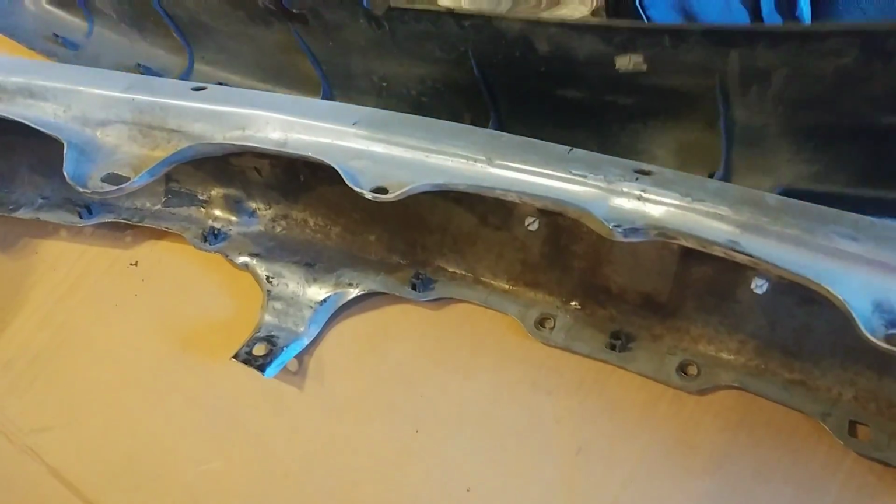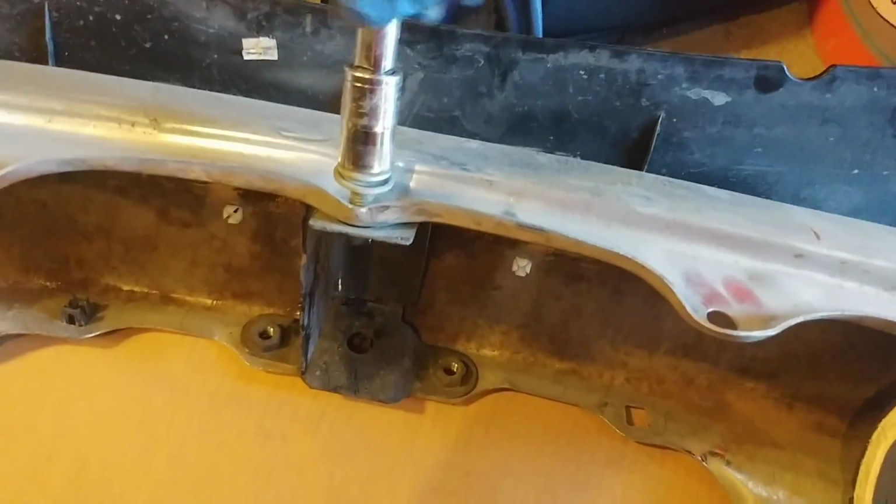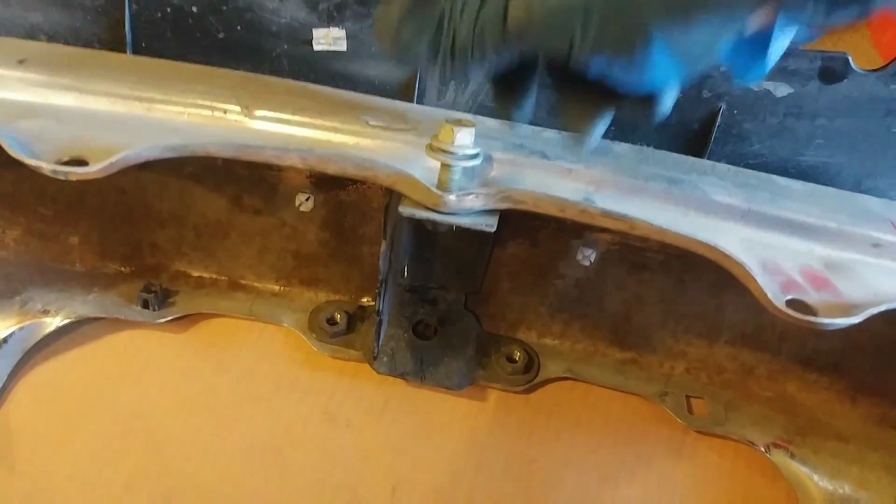The upper plastic is held on by these friction push tabs. They're accordion style, so they're designed to be squeezed, collapsed for removal and pushed out. Same basic concept. You know, if you're careful with this stuff, it'll survive. Let me give you a close-up look at what these look like. So you can see the accordion design. When they're going on, it's very easy. You just kind of push them in, and they're friction held.